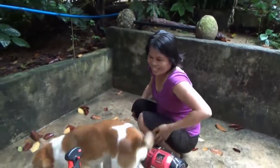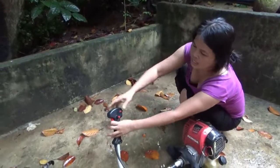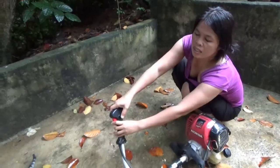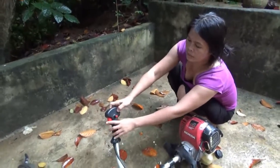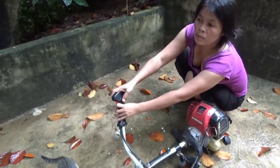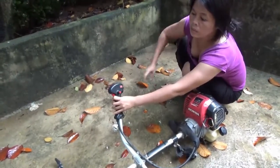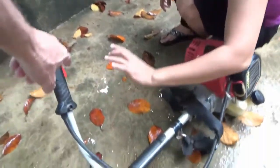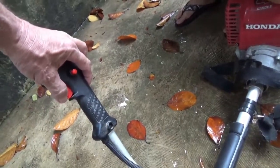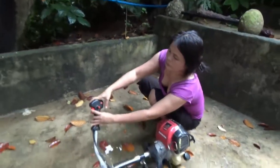Takes two hands, huh? On. That's off now. On. And then that, and let it out slow. No, do it all over again. Don't worry about the switch. Push the red button in. Now let the front part out real slow and keep the button pushed in. No, you gotta push this in, and get it tight. Push the button in, and then let this one here out real slow, and it'll lock right there. If you can't do that, you can't restart the machine.